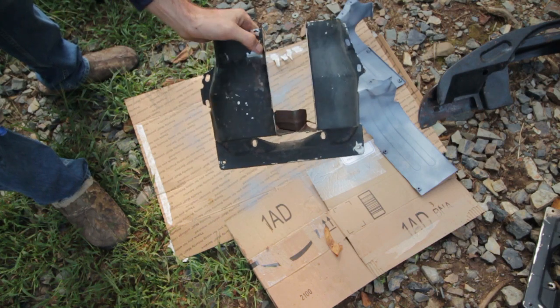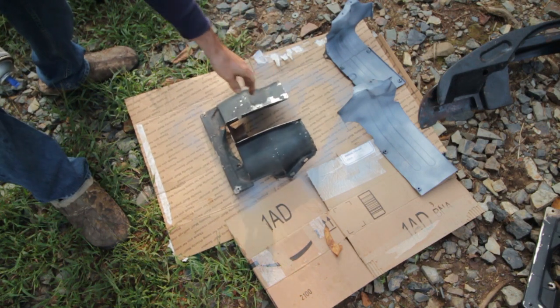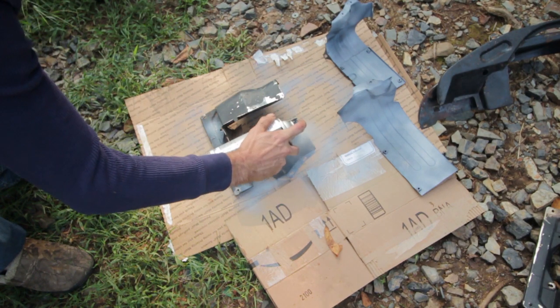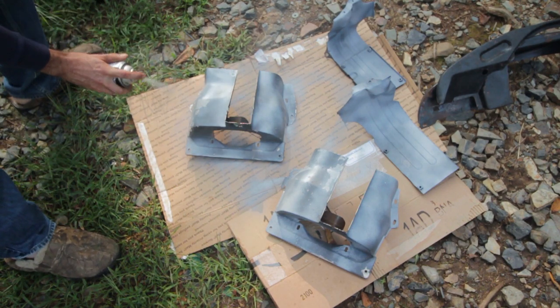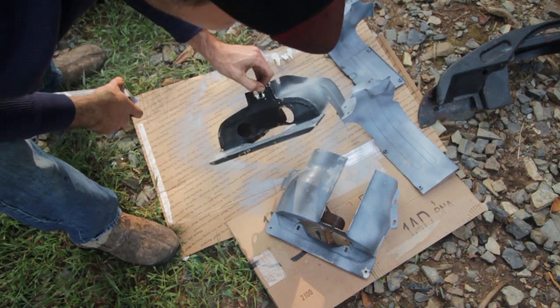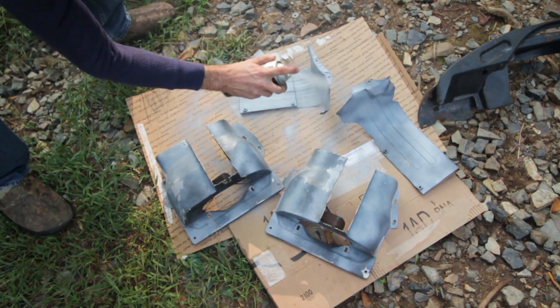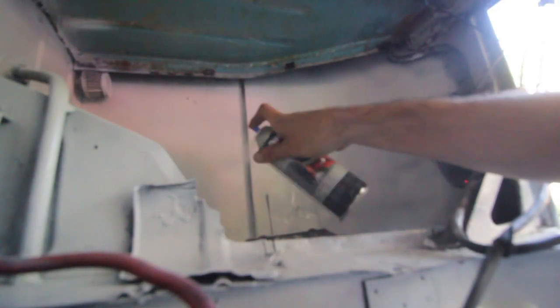I hope nobody gets mad at me. I think this was actually a chrome engine kit before they painted it the first time, but a lot of the chrome has come off and it's kind of rusty. I'd never get all that black paint off, so I'm just going to go ahead and paint it. This is just primer, but we'll do the same thing with the paint - we don't want to put too much on in one layer. If you want to get good coverage on these, you just want to do it a little less in one coat. It looks pretty good. You can see there's some paint chipping right there - I'll let it dry and chip that off, then just repaint over it.